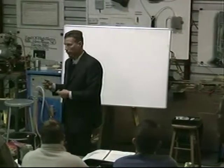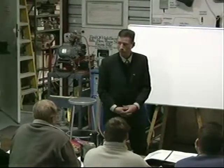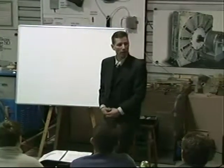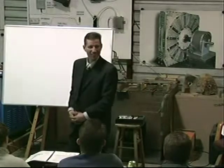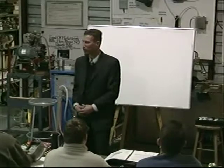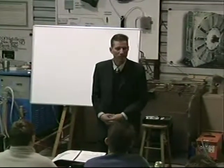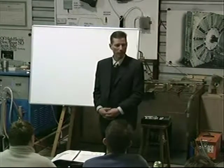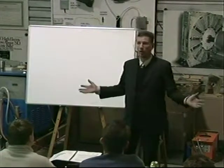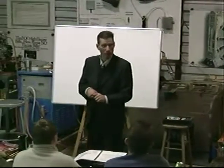Now, we have a nice metal housing on there. If we're not getting a whole lot of heat from the cooling system, bet we could get a whole bunch off the exhaust system, huh, guys? Yeah, I thought about that. Strap it to the downpipe, and man, we'll be vaporizing all kinds of fuel. And vaporizing fuel pumps and vaporizing injectors. That's not a good idea, in other words. That's too much. The fuel itself would love to see 450, 500 degrees coming through that injector, but unfortunately, the injector can't handle that much.